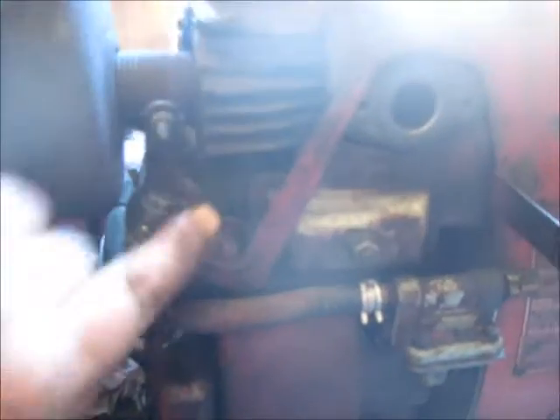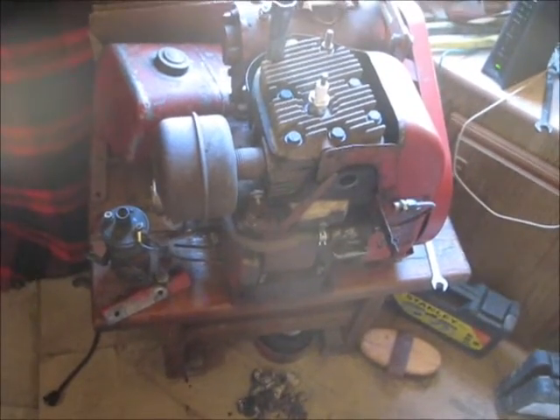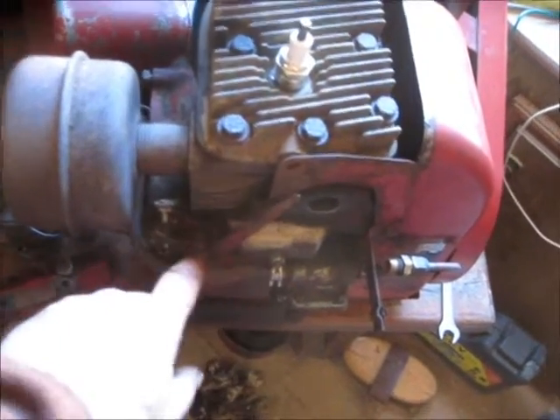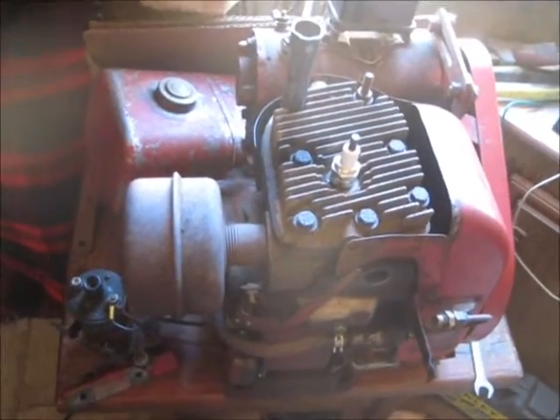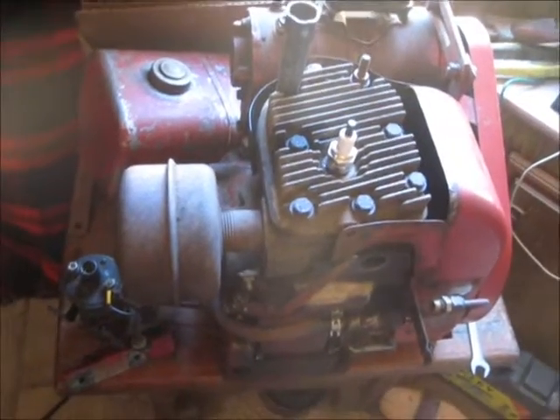After I got into it, I tried to adjust my governor arm and it just turns and spins and won't tighten up. I'm thinking the governor arm was broken because once it gets under a load, it'll shut down. I could swear that when I was adjusting it, I heard something fall down inside the engine. So now I've got to take everything apart — me and the mad scientist has got to rip it apart and bring her back to life.